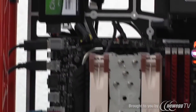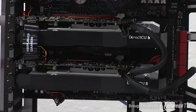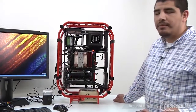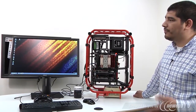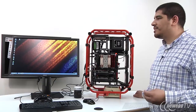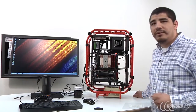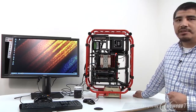What we're really focusing on here are the GPUs. We've got our ASUS GeForce GTX 760 DirectCU 2 graphics cards set up in an SLI-based configuration, taking advantage of the Maximus 6 Hero's SLI support with additional spacing for airflow. Most of you have asked for 1080p information, but the benchmarks we're showcasing are all at QHD resolution — 2560 by 1440 — using our high-performance PA279Q QHD monitor. Keep in mind that if this card performs well at 2560, it will only perform faster at 1080p, whether in single GPU or two-GPU configurations. Let's jump into temperatures first.